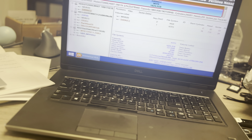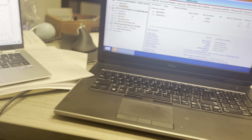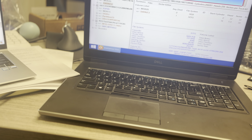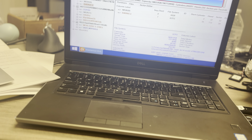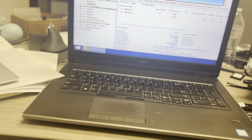What I did is I used something called Disk Genius. Disk Genius is what you use to format a drive from a bootable disk. The reason you do that is because you can't boot the C drive and format it while you're actively using it. So you have to boot to a bootable disk to format both drives. I formatted them because he wants it wiped clean.